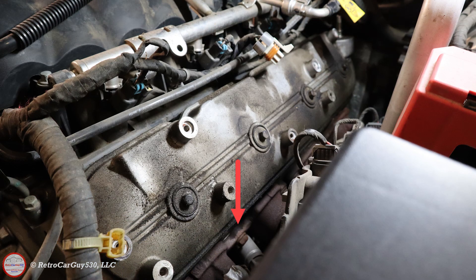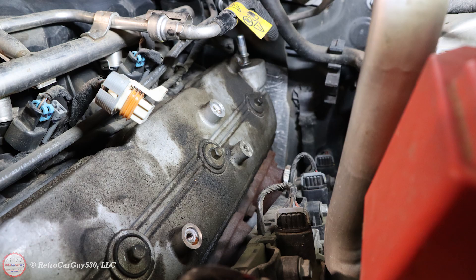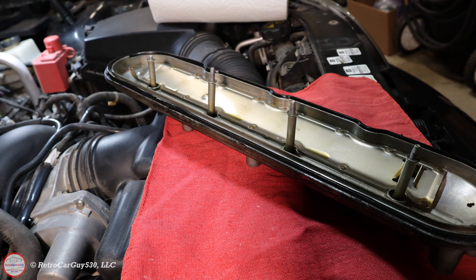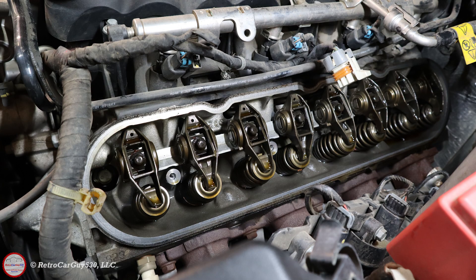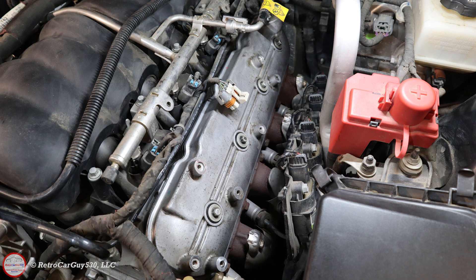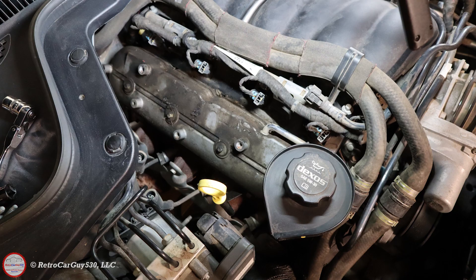This week I addressed a safety and maintenance item on the Caprice — the valve covers were leaking, with oil running all the way down to the exhaust manifold on both sides. I removed the coil packs, disconnected the connectors, removed the bolts, then loosened the four bolts holding the valve cover. You can see oil on all edges of the valve cover. I removed the gasket, cleaned up the surface, and installed a new gasket and grommets for the bolts from RockAuto.com. The valve train ended up being just fine on both sides — I cleaned up all the grime carefully to avoid dropping anything into the valve train area, then put the cover back on with the new grommets.